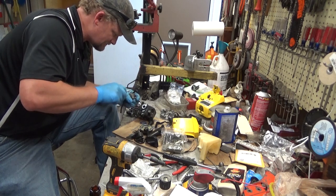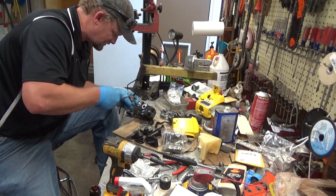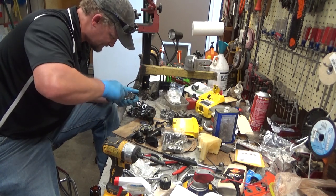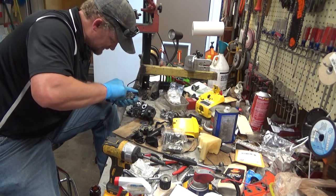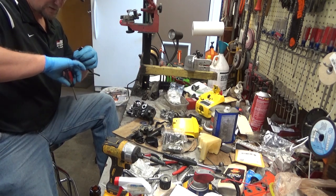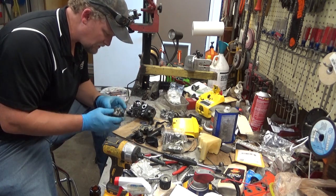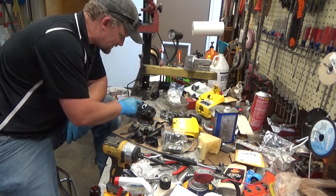And he was right. There's nothing wrong with a 35 or that series of saw, but I do personally believe the Super 2 is a superior saw. Less prone to flooding and a little more torque. These things, I think, rev a little higher, at least it always felt like that, but didn't quite have the torque of a reed valve engine. These are piston ported, wide open there.